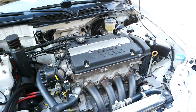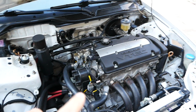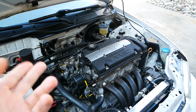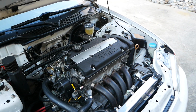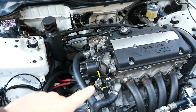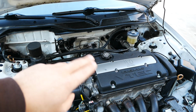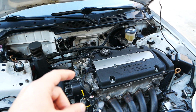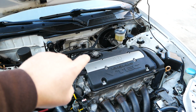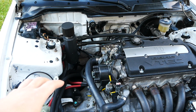That is an RLZ race head, CNC ported, with a set of DDTech Stage 3 cams. Now, it's NomisInd cams. He bought the rights to that. With a Rywire engine harness. Now the Rywire I'm going to take out right now, and I'm going to trim out a few wires, extend them out off of a Deutsch 12 pin, like a DT 12 pin, and so I'll extend my air inlet all the way to the box because I like having a direct, non-heat-soaked air temp.